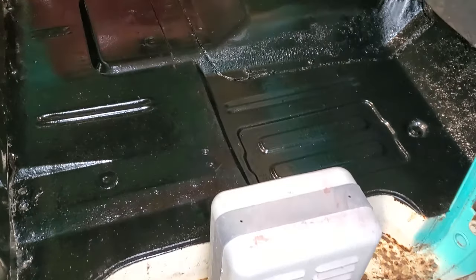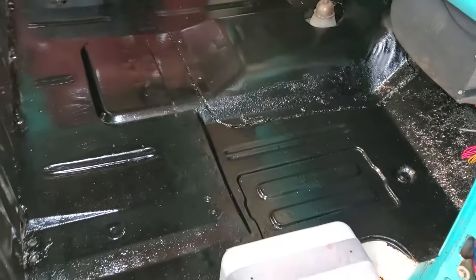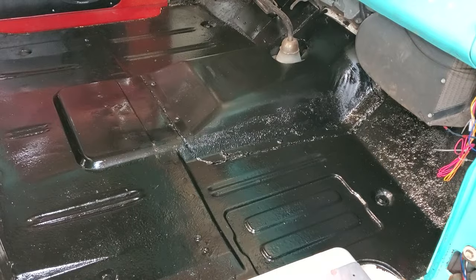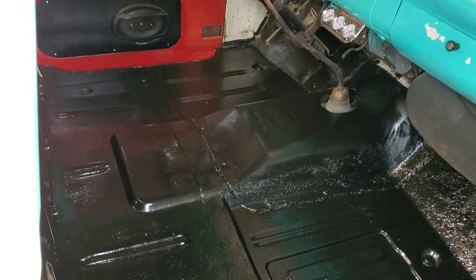It's starting to look really good. I've got a space heater on it, everything's nice and solid. It's still trying to cure — a little bit tacky still — but for the most part that's going to be it for this POR-15. That's going to conclude that part of the interior build of the truck. The POR-15 is going to help to really seal in that rust and prevent it from creating more rust, because rust is like cancerous almost — it'll just spread and spread. POR-15, you can paint it right over top of that. It'll help to seal it in, prevent moisture from getting in there, and it's a super solid waterproof finish.